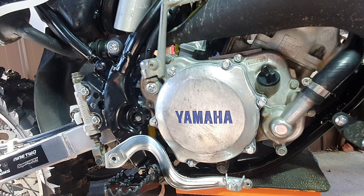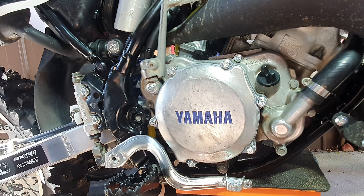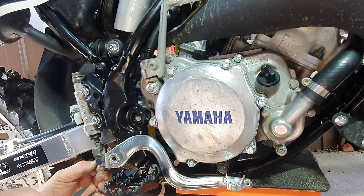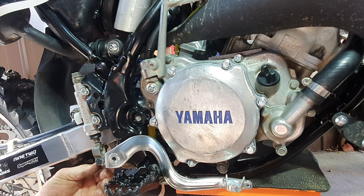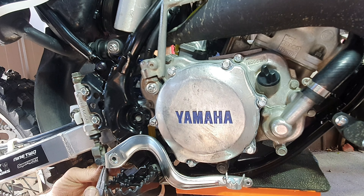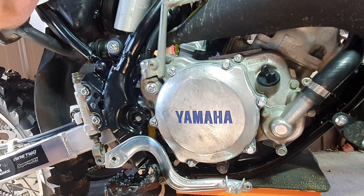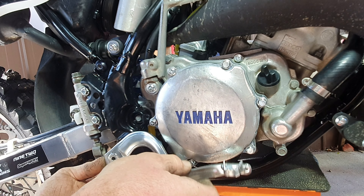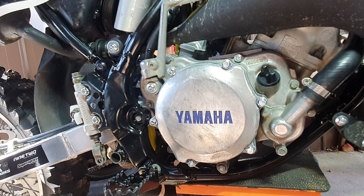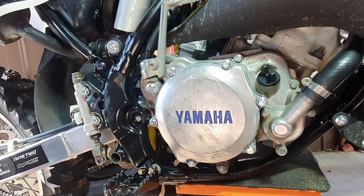So that's what you look for. We want to pull the brake lever off first, remove the spring — I'm not going to lose any parts. There's just a couple of split pins to pull apart and remove. I've had this thing apart quite a few times. Rear brake lever done.